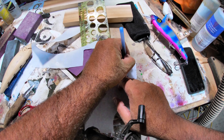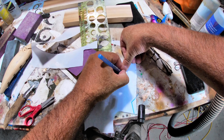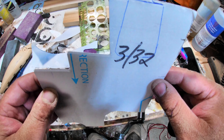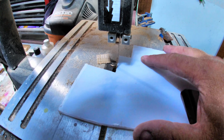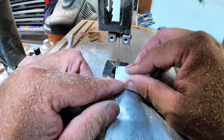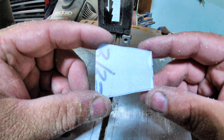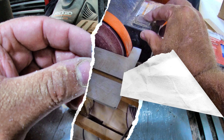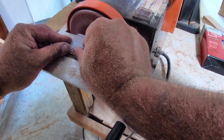What I like to do when I'm sanding these is go from the center down to the chamfer line on the body, and that will all get smoothed out. We'll do that on both sides and all on the bottom. Everything's all sanded out and it looks really good — nice and smooth. Our sealer will go on, we'll put a couple coats of sealant on it, then a primer coat, then epoxy over that, and we'll start painting. Let's get this diving lip done first.